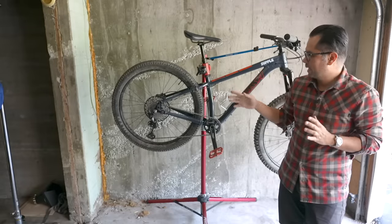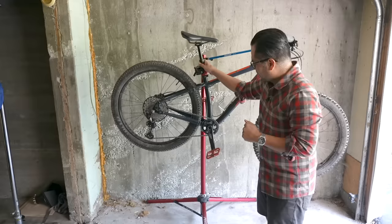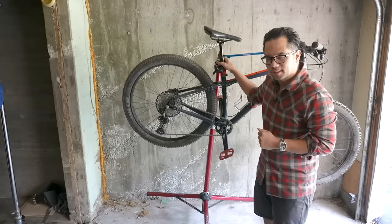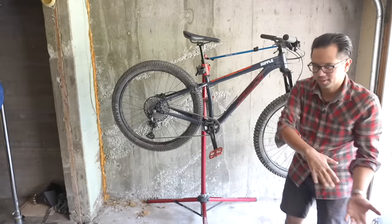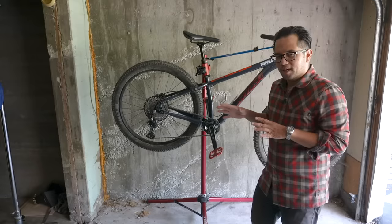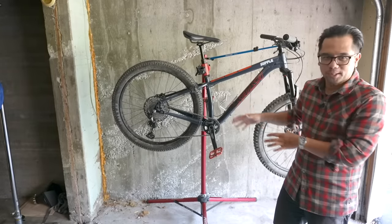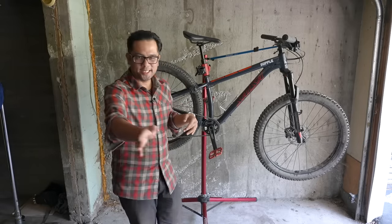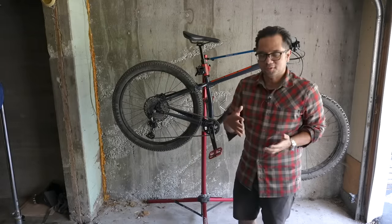This mountain bike is about 30 pounds, and I've found this is kind of the upper limit for this style bike stand, otherwise it gets a little bit tippy. You can see it doesn't take a whole lot to destabilize this rack. I've had it where I've removed a front wheel and the weight gets thrown off and the whole stand almost falls over. That's one of the issues of this tripod foot design — you really have to be cognizant of how the weight is distributed and anticipate how it will change when you remove a front or rear wheel.